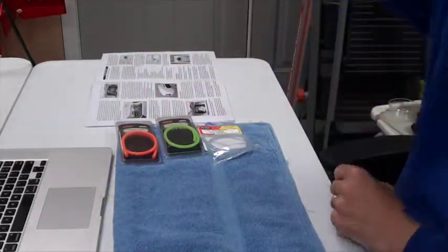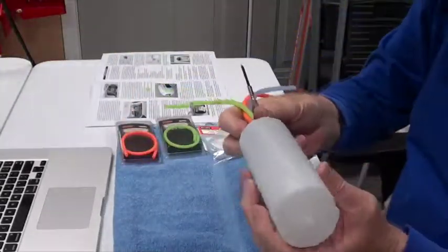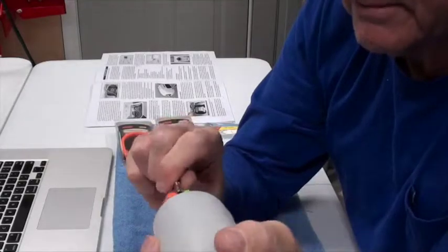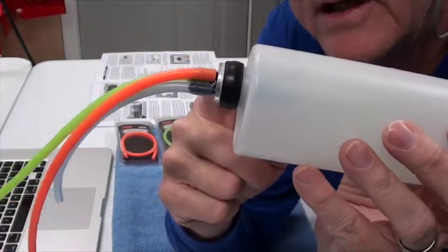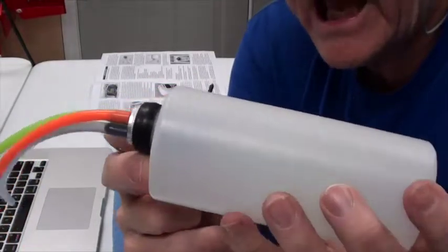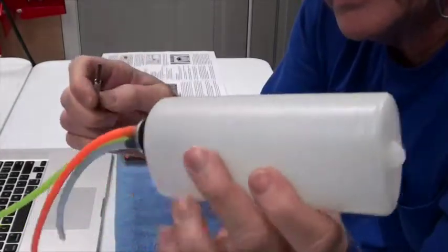Once you've inspected it and can see the clunks aren't hitting the bottom and will lay on the bottom of the tank nicely, go ahead and tighten the plate. Don't tighten it too much because the tank will split, but get it tight enough to expand the rubber part of the stopper so it seals well. I like the design of this stopper — it seals well, I like how it lips over the edge, and I like that it came with three tubes already in it. Now I've got it reasonably tight without splitting it.